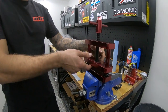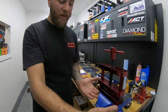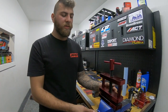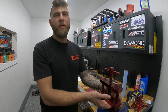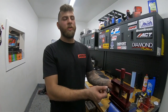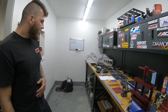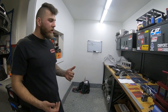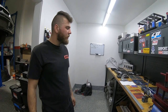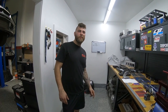This is an aluminum rod vice — we use it so we don't have to clamp aluminum rods in a steel vise when measuring clearances, since that could crush or damage them. That's pretty much it — thanks for watching. We just wanted to give you an idea of the tools we use for engine building here at JRP Performance. Stay tuned, we've got a bunch more videos coming.